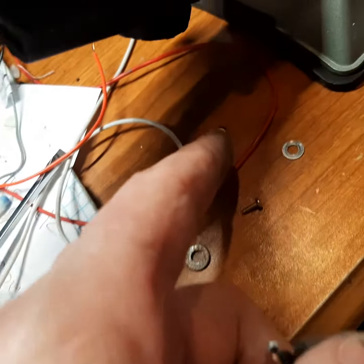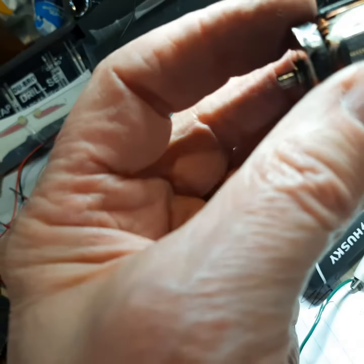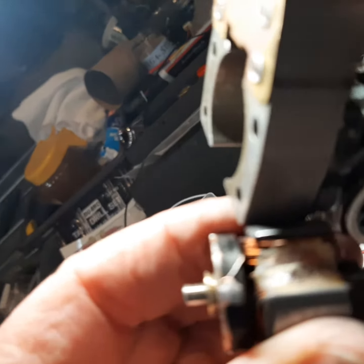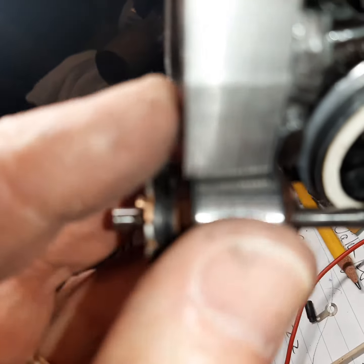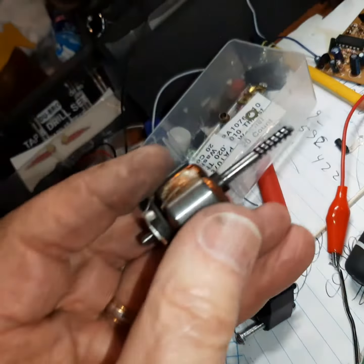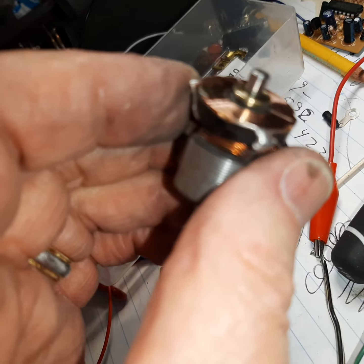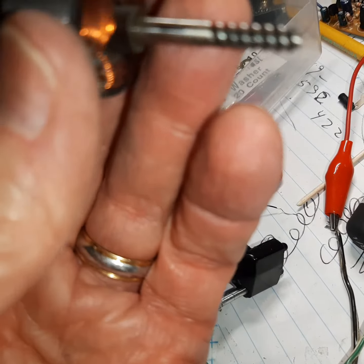The other thing I'm doing is stacking up my shims for the clearances to see what I needed in the way of backlash. This thing was way off — it was like offset. It wasn't lined up with the armature like it's supposed to be. It's supposed to be lined up like that. So it is now, and I'm making some clearances. I thought while I had it out, I'd reface the surface for the brushes to make sure they're nice and clean and don't have any dips. So this armature is really good.